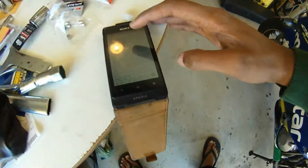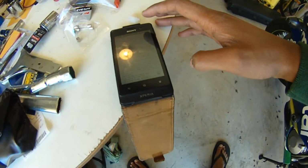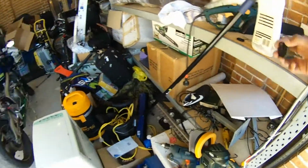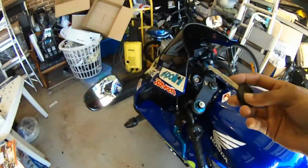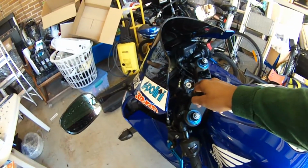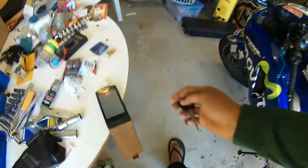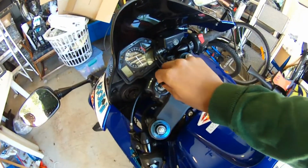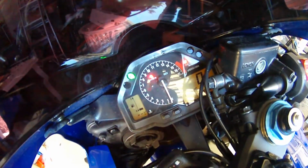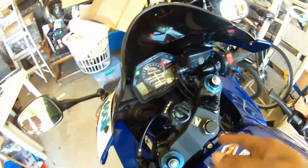So now what we need to do, I believe, is remove the ignition. So the main ignition key, we turn it off and we remove it. So let's turn that off, take that out, keep it far away. Now we take our spare key, which we've already cut, hopefully, and we try the same procedure. So you want to keep the main key as far away as possible to avoid confusing the system. So we put in our spare key now, we'll turn it on. See what it does. 1, 2, 3, 4, and it repeats 1, 2, 3, 4. So that means our spare key is now registered.